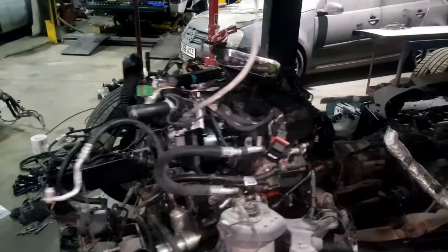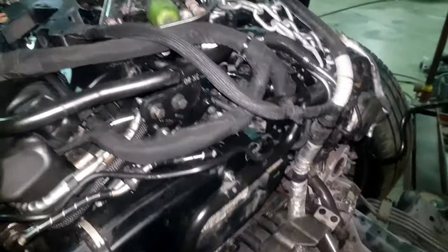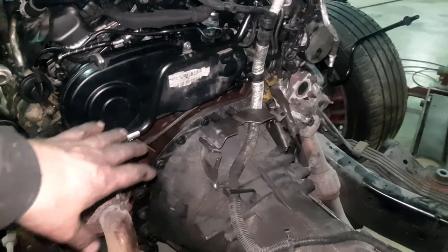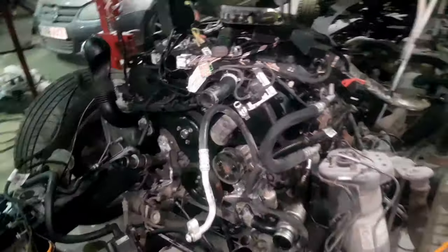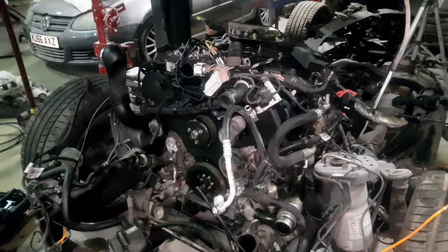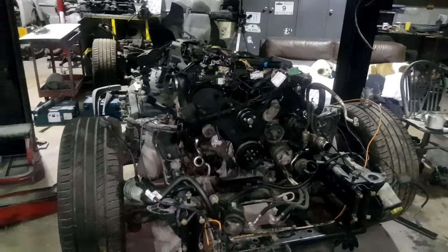That is going to conclude this one. My goal was to get the engine in and the engine is in. I've still got quite a bit to button up yet, but it is in the chassis. Quick walk around: most of the work is up the back - bellhouse bolts are in, gearbox wiring harness is routed through and up on top of the engine. We were going to put the crossover pipe on but forgot to put the shield over the fuel pipe, so that'll be next time. Coming along quite nicely. Should I commit to saying next episode it will be running? There's still a fair bit to do so I'm not going to make any promises. Thanks for joining me, see you next time.